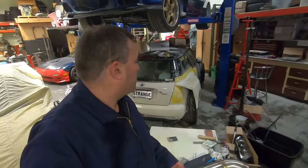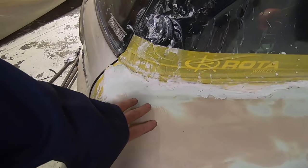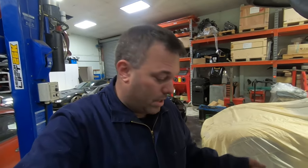Benny wants some playtime! As you'll see on the guard, there are actually two colors of body filler. As it turns out, the pink stuff is super hard and the green stuff is what I should be using in this application. So I'm going to forego using the pink stuff anymore — I've got another five liters of the green stuff. I've also bought a DA sander with the appropriate attachments, which is going to take a lot less time than doing it by hand. Also wearing overalls this time so I don't get absolutely filthy!